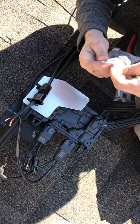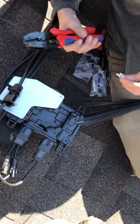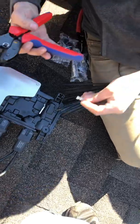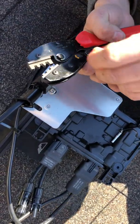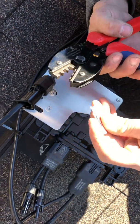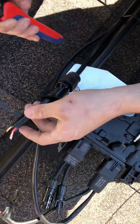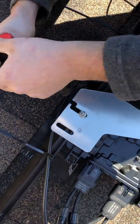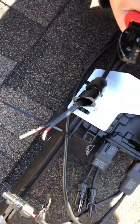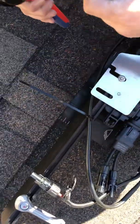Back to the pins of the female connector — break them through the plastic. This side is for 10 gauge, although the writing has worn away. The middle is for 12. So I'm going to put the pin in the 12 slot and crimp onto black, then put the pin into 12 again and crimp onto red.